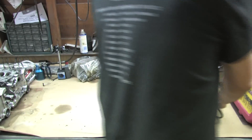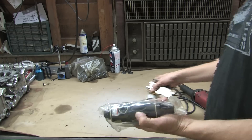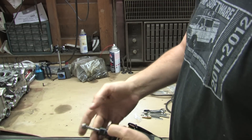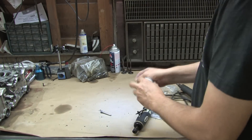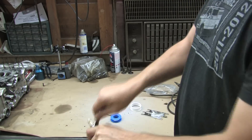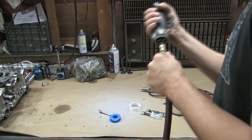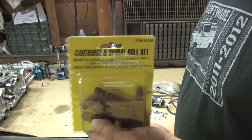What you really want to use is something that gives you variable speeds and gives you the flexibility to start and stop on a dime — something you can get a good grip on. So I picked up a straight shaft pneumatic die grinder, and this thing is perfect for this job. If you have to use a burr, they fit this collet and you can reach into the shallow areas. If you need to get deep into the head, you'd need a very long shaft on it. You can run it at high and low speeds and regulate the air supply to slow it down even further.